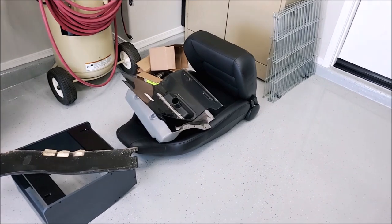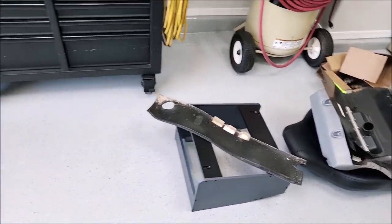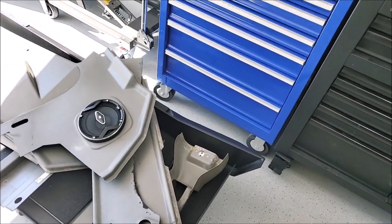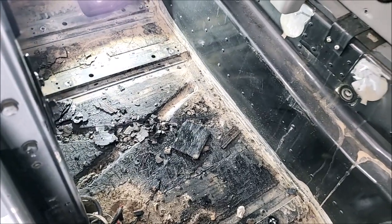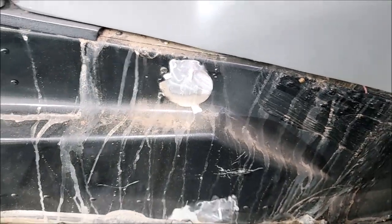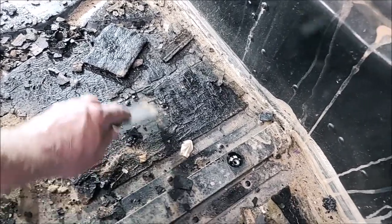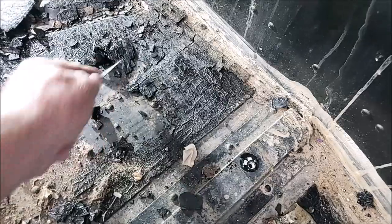That went well. Here are the parts I don't need to do anything with — the seats, crash pads, front parts, seat brackets. Down here are all the interior plastic pieces I need to sort out, get the speaker taken out, get them all cleaned up and ready to go. On the inside it leaves a big dirty mess to clean up. Be careful with the aluminum studs in there — this one is actually broken, but I have a stud welder so I can grind it off and weld a new stud on. At the bottom it looks like there was a forest fire in here, but it scrapes up pretty easy.